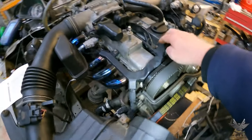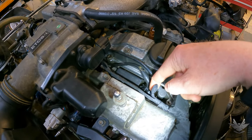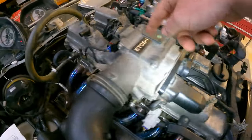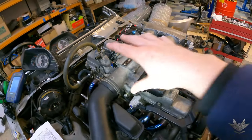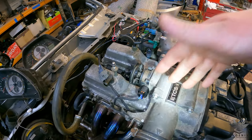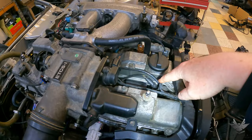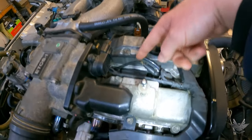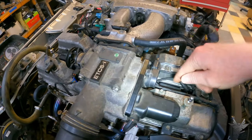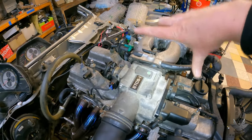Now we're going to come down over here. This piece of plastic goes all the way across and around. The first breakout is in the middle and that's for your coils. You've got one plug splitting out for coil number three, then a bit more forward for coil number six. In terms of the firing order on the wasted spark system, it fires two spark plugs at the same time: coil over cylinder six but its HT lead goes all the way to cylinder one, so six and one fire at the same time. This one is two — so two and five fire at the same time. The one going underneath to number three also fires cylinder four — so three and four fire together. So: 1 and 6, 2 and 5, 3 and 4.